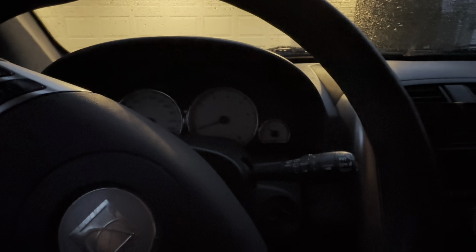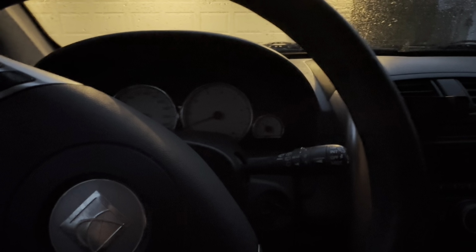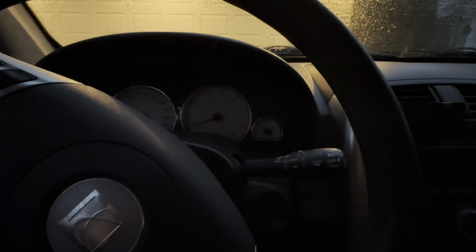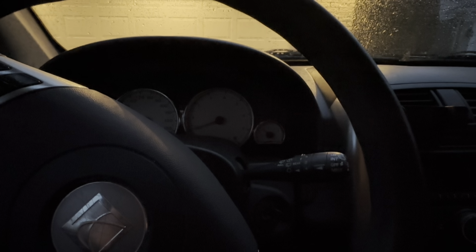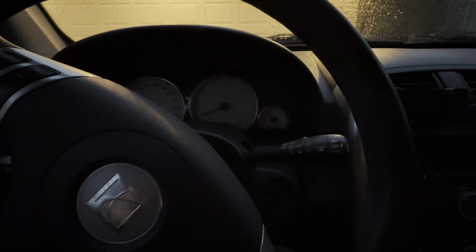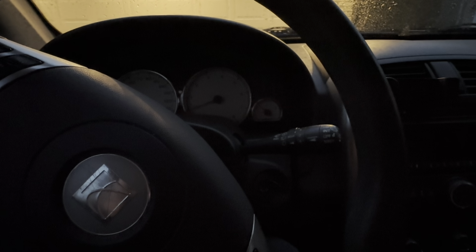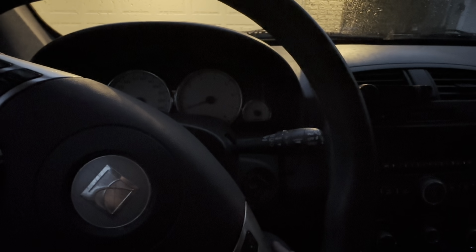In this video, I'm looking at a 2006 Saturn Vue. This one was brought to me with a brake pulsation complaint, and I decided to take it around the block for a quick test drive. Seems to me that the rear brakes are pretty much done for. I noticed when I was driving it that you don't feel much of a pulsation in the steering wheel, but you definitely feel it in the brake pedal.